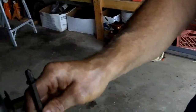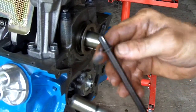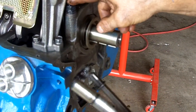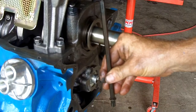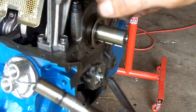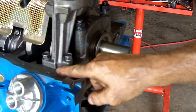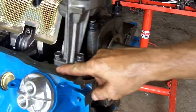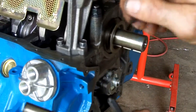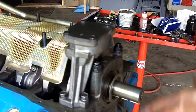The other reason you have to trial fit is when you put this in you sometimes have to pound this down. What you can do is take a plastic hammer — and this goes in like so — and then if there is not enough clearance you just give it a little tap so that there is enough clearance to put the pump on. The pump has to fit square with the block, so if this thing is hitting the block over here, you have to give it a little persuasion to give some clearance so that it will fit into the pump. And that's pretty much the deal.